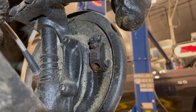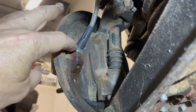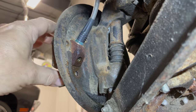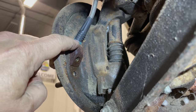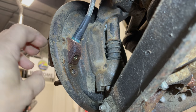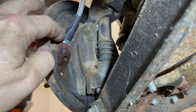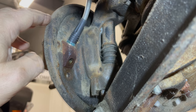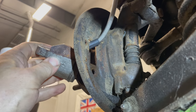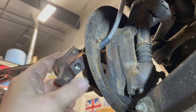Here's the little pipe that runs between the two wheel cylinders — I've got that out. Just take the two bolts off and it'll fall out. On this cylinder we have the brake hose coming down to it. This is not the side that can spin without twisting the entire hose, so what I've done is loosened it a little, then I'll wiggle the cylinder out and unscrew it from out here. When I install the new one I'll screw it onto the hose with the hose sticking through the hole, mount it back up, and tighten the last bit from there — that way I don't have to take the entire hose off to replace this.